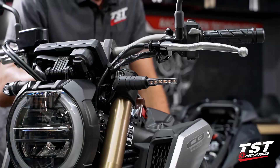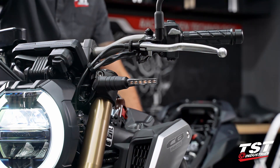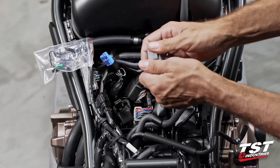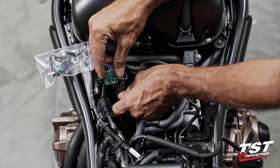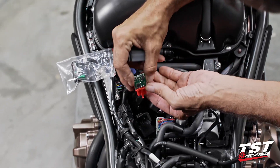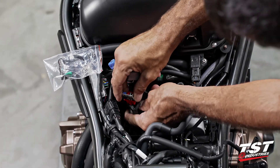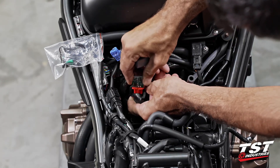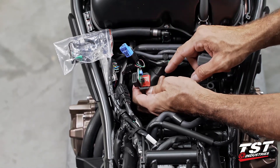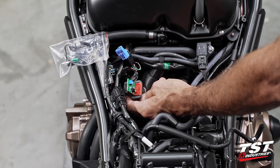Simple plug and play — and we can test it. It's flashing at 85 cycles per minute, everything's operating properly. If you want to adjust beyond this speed, like I said in the intro, you take it out and plug it in. You can use the keying of the connector, or actually leave it in the connector — that's probably the simplest thing. Plug it back in and make sure the pins interface with the pins on the female connector. A very important point: keep this isolated from any other components and don't touch ground — you can ground it out, short it, and that will blow a fuse.